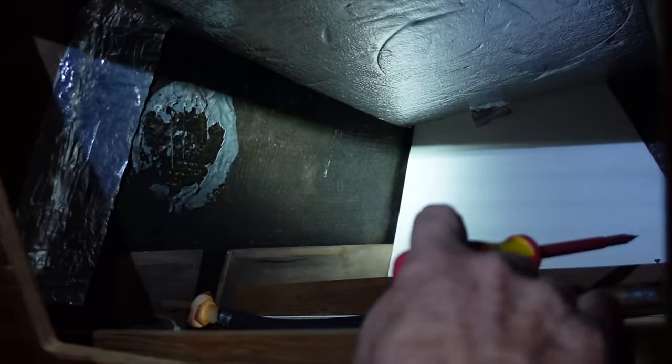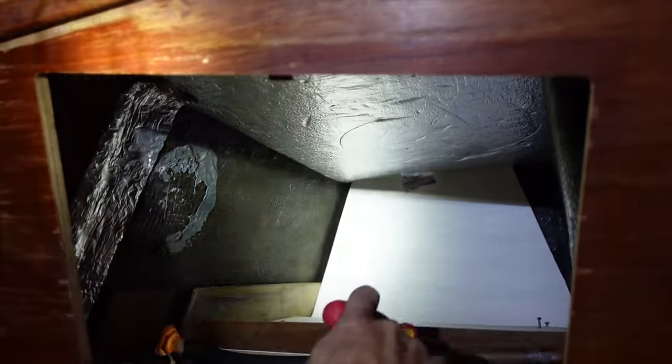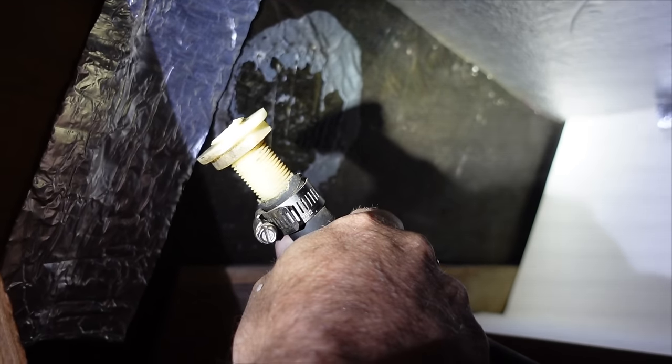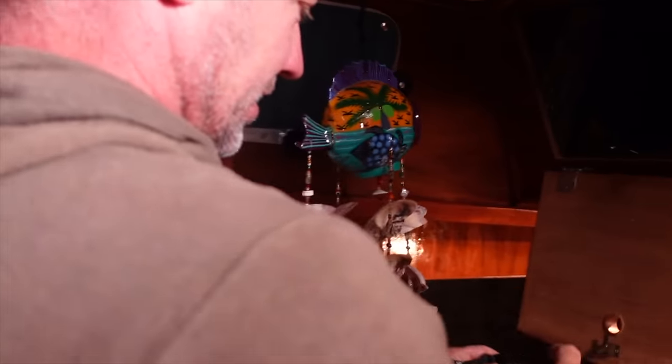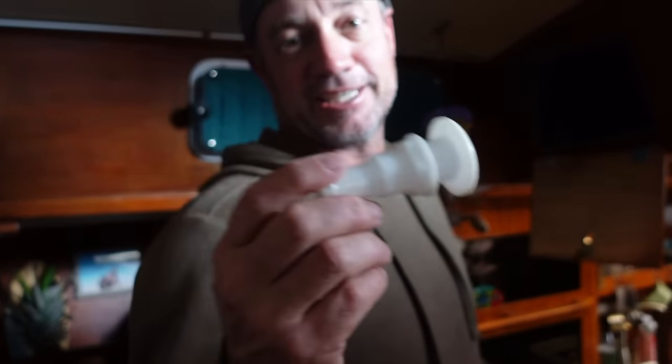Let's go inside here and have a look. This here is just solid glass — this is our backrest in the cockpit, and there's the cockpit seat drain. So it goes from a fiberglass stem into a hose, and then it goes to a through-hole — a skin fitting. And that probably shouldn't just come off the wall like that. It has just shown its age — half of it's on the outside of the boat and half of it's on the inside. Luckily we do actually have a spare one — Perko three-quarter-inch plastic skin fitting. That's actually what drains our cockpit. It's like a five-minute job: 4200 it and put this back on, connect the pipe up and call that done.